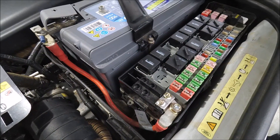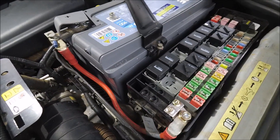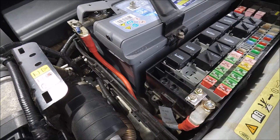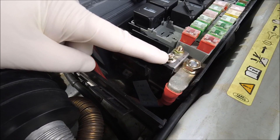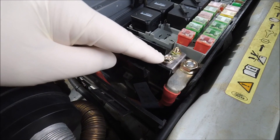There are five wires you need to install to set up the FBH controller. The positive wire is the black wire with the fuse connector inline, and it already has a red crimp on the end. This wire goes to the terminal on the main bus bar going to the fuse box — that's where you put your crimp terminal.